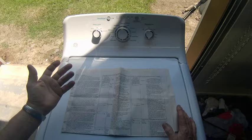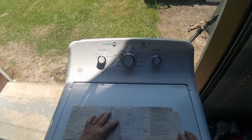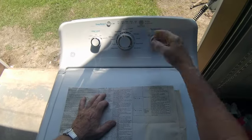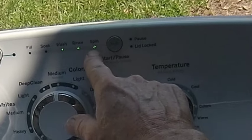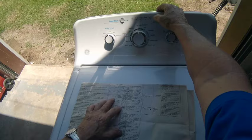You can either get the fault codes and look up the faults, but I just have better luck testing every individual component. Like a hot water valve — let's make sure. Turn the water on. It has the hot water valve — we need these two lights right here on, which is this one and this one. Turn it clockwise until those two lights are illuminated. Push the button, then the water valve opens. Push it again, it stops. Check the cold water valve — one more click clockwise, these three lights come on, push the button. The water valve is working fine — they even have a fabric softener.